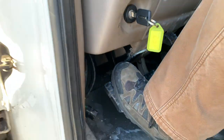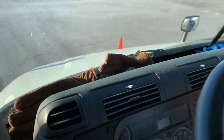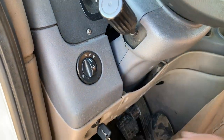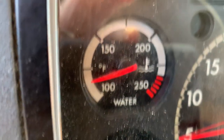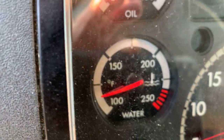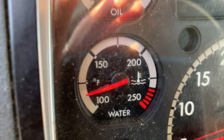Now we're gonna start the truck up, another practice. Make sure the hood is down, which it is. Start her up. Now we're not gonna touch the shifter, but we're just gonna work with the foot. We're gonna do a simulated downshift. We're gonna clutch, rev, clutch. Right now, since it's idling, RPMs is below 10. When we drive on the road, RPMs are gonna be somewhere around 10. You wanna clutch, rev it up to about 14, and clutch the gear.